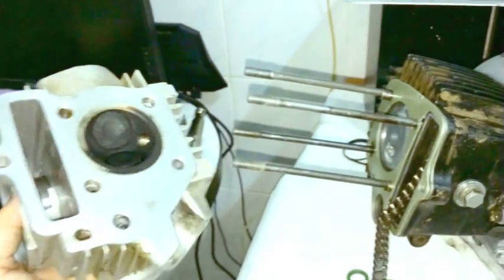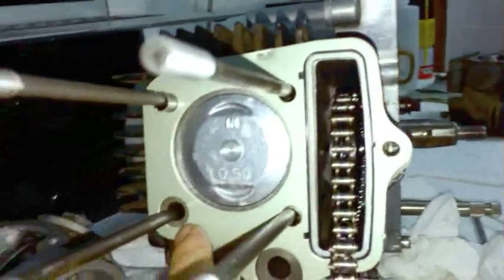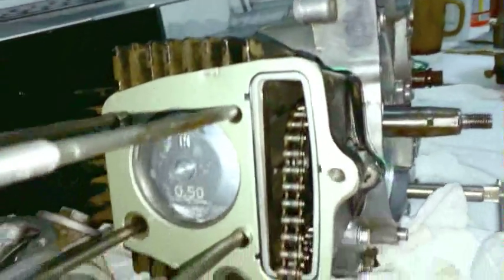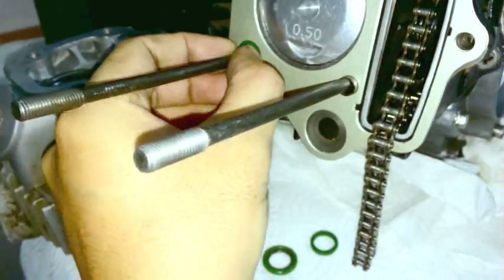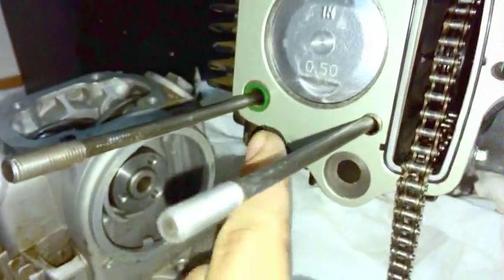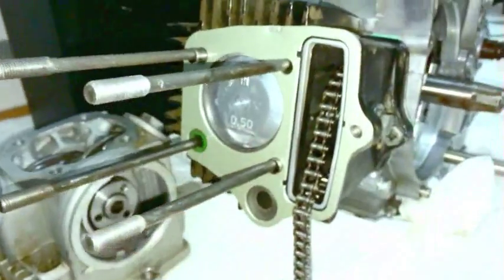But before you put this on, if you have an oil feed O-ring, and you can tell if your bike has this, you're going to have to put the O-ring on before you put the cylinder head on. The O-ring has to go on first, so don't make that mistake that I did and have to refill everything. So put this O-ring on first, because obviously once you slide on the head, you're not going to be able to get it on. This O-ring down here,